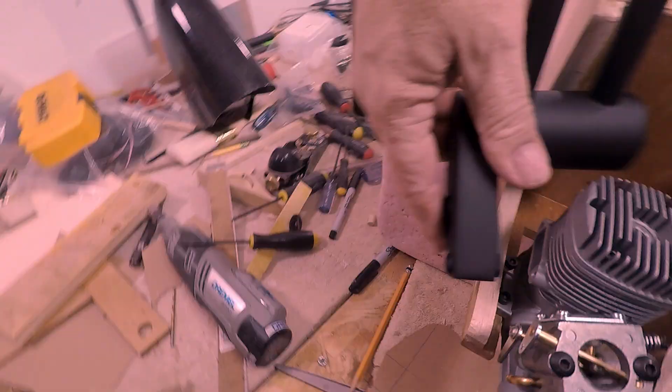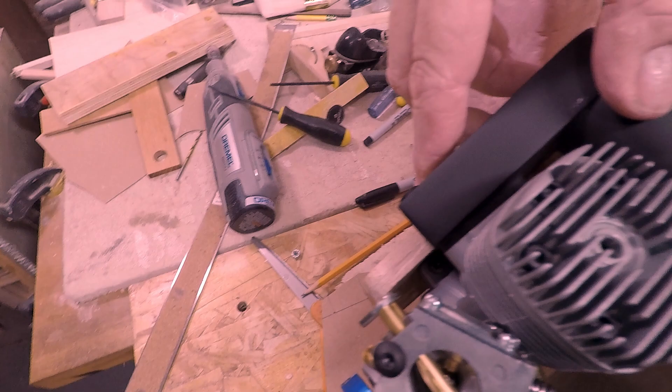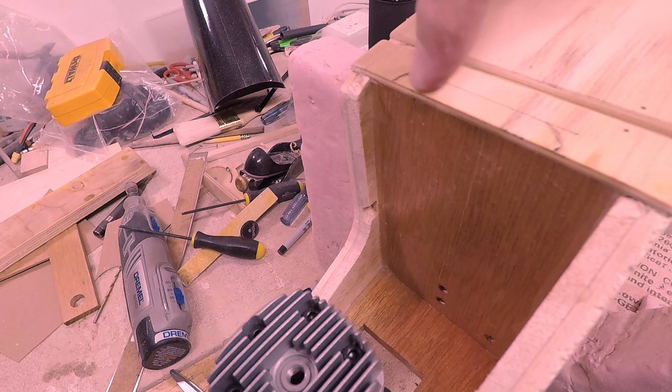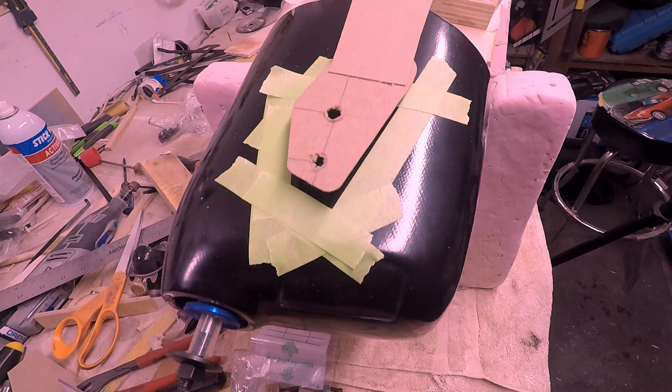Here's how it's going to come on - and it is standing a little bit proud, so I think it's going to end up bumping the cowling. So if we have to open up a little bit of the side, we have to - we don't have a choice. I went ahead and already kind of scratched in where I'm going to have to remove material. It's not going to be a whole heck of a lot, so I'll just go in with the Dremel and a little grinding bit and get some of this stuff buzzed out.